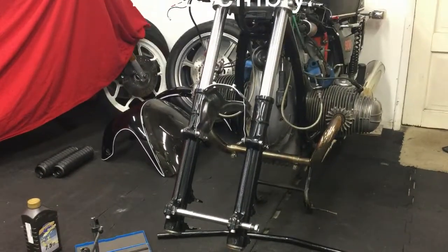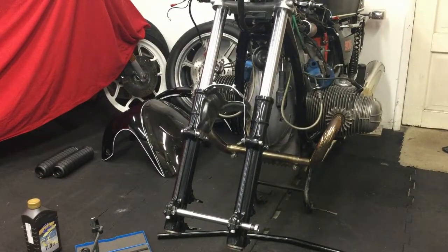I'm in the process of rebuilding the front end on my R90, and as I began the reassembly process, I noticed that I had ever-increasing stiction. I was measuring that using a dial indicator in X along the fork tubes, and for Y I was using a glass plate.